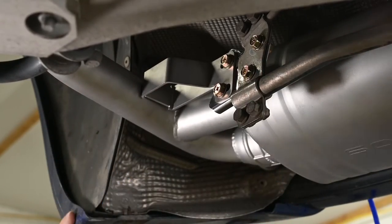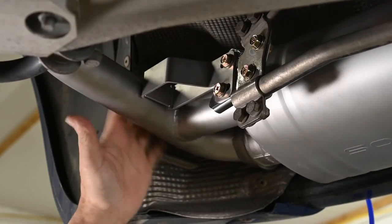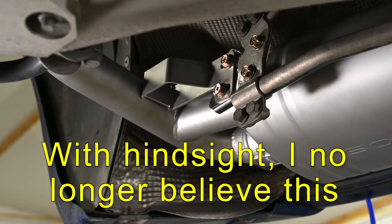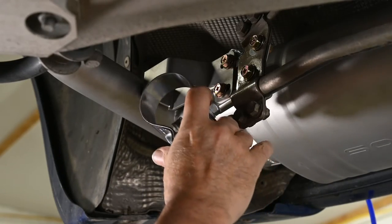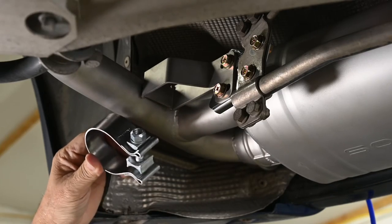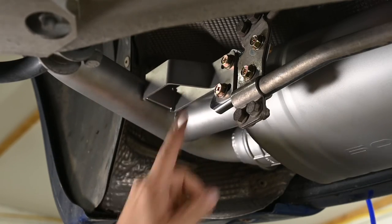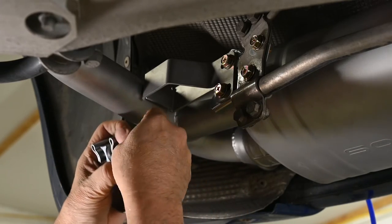One thing I should mention is that by the time you get this up in here, the valve is very close to the underside of the car. So I went ahead and installed the lines on each one of the valves, because I think it would be extremely difficult if you do that after this is all in place. Based on my experience on the other side, this is the worst part of the installation, and that's getting this clamp on here. You have to get the clamp around the pipe and around this brace and then clamp it together. The problem, or what makes this such a challenge, is that